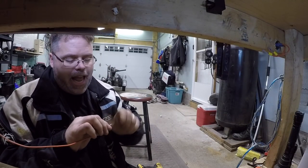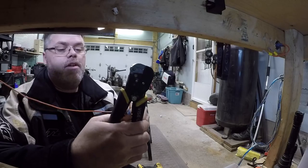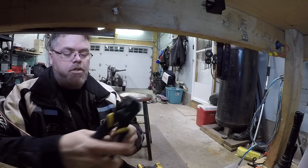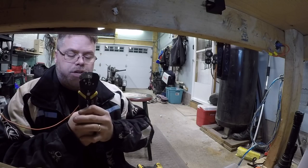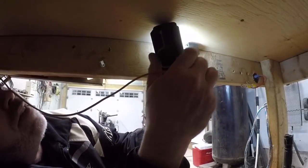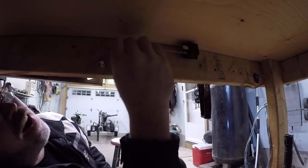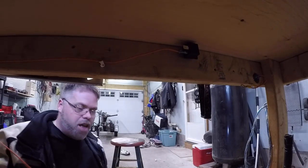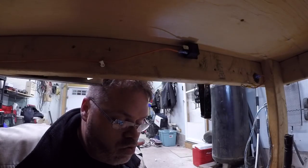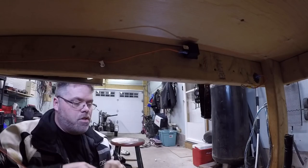Let's go up here. Relay mounted. So we need ground. It's almost not long enough — let's turn it that way so I won't hit anything. We need to cut this off right about there, just like that. We need to splice it, give it a twist. We need to take one of these connectors, throw it on there, and crimp it. Oh it didn't crimp very good — let's re-crimp that thing. We got her that time.